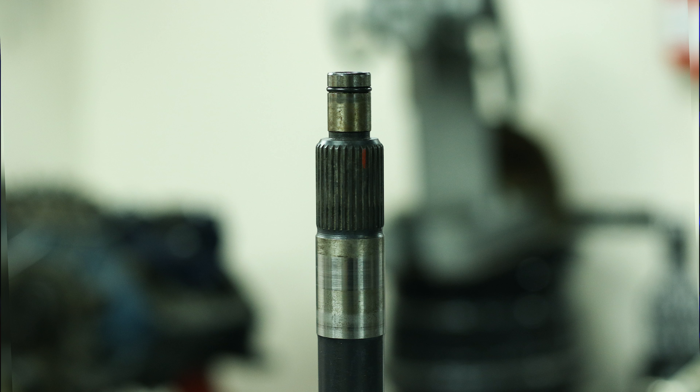And it just sounds like a big headache that could be avoided by buying a new O-ring. Speaking of buying a new O-ring, there are two different types of O-rings because there are two different types of input shafts. The 298mm converter and corresponding input shaft was used in 4L60Es from 1993 to 1997.